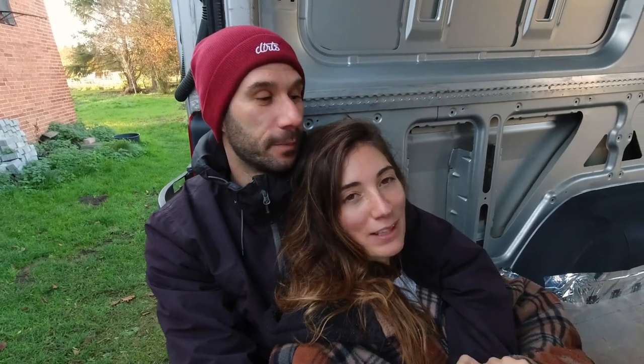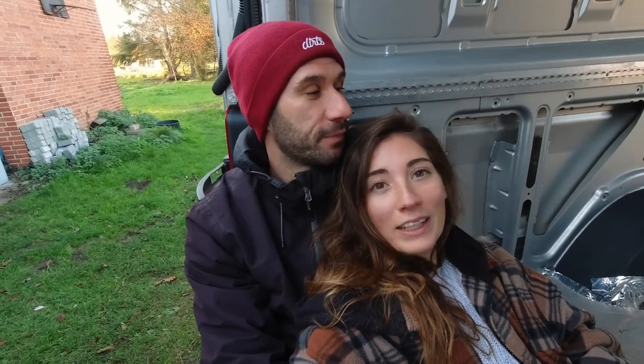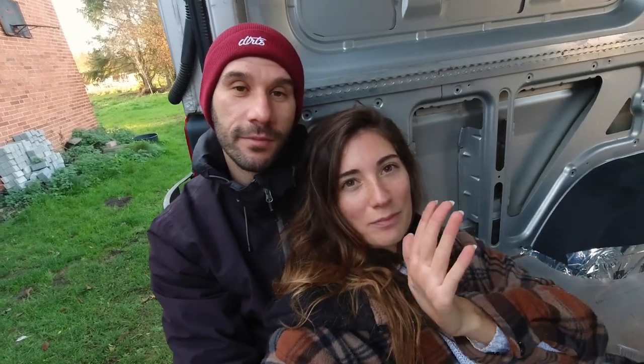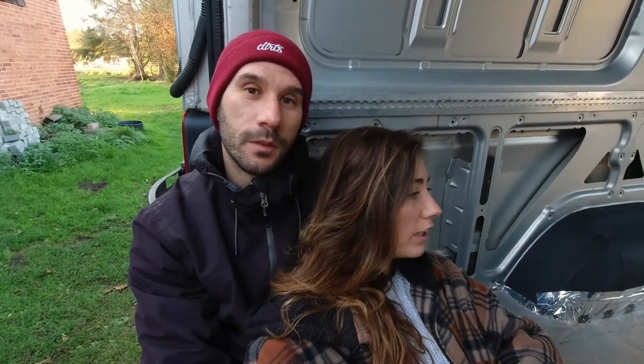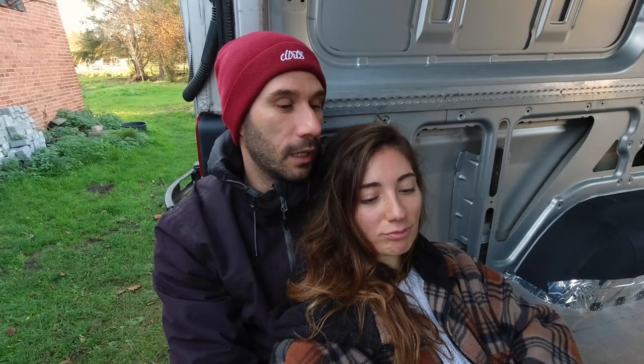Yeah. And maybe one mistake we also made in the last two months, let's say, is that we stored this floor in a garage, but with one side open, and it was hit by the sun, by the rain, by the wind, and that made the floor a little bit bent. And we stored it standing up straight, and that probably was not really clever either. So if you store your floor for a few months, don't expose it to the weather and try to keep it flat somewhere. Yeah, if you've got space, because they are huge. We didn't actually have the space to put them flat as we wanted to. But next time. And you guys, don't make the same mistake we did.